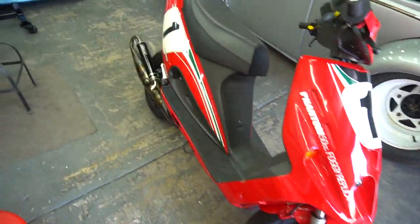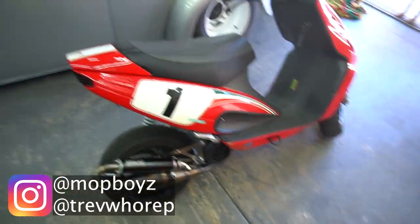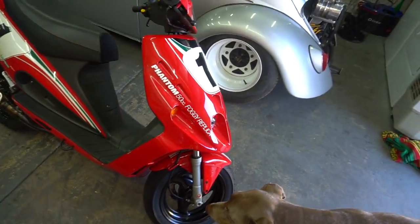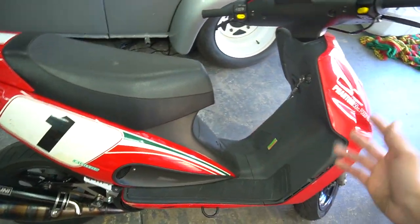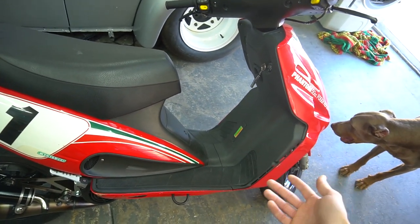Back to work on what is probably my most favorite scooter I have, the Phantom F12 - horizontal Minarelli and straight ripper. As you saw last time, we got this thing running a whole lot better than it ever has. We had a lot of issues getting this thing on a base setup, swapped the carb over from a CP19 to a CP21, opened it up a little bit, and now we have some action going.